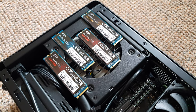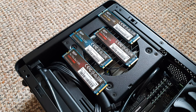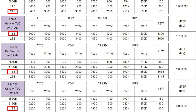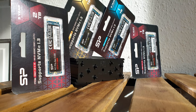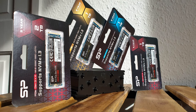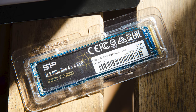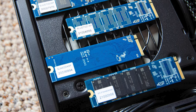From top to bottom we have the only Gen 4 X4 US70, then the UD70 which uses QLC cells, and then the A80 and A60 series. Pricing will be linked in the description below since there are too many models to cover in one go. All the models come shipped in a minimalist yet effective enclosure that lets you see the actual M.2s, with differences in color theme and stickers so you can tell them apart. Opening them up, this is the minimalist transparent plastic clamshell that protects the SSDs. All of them use a blue standard PCB and the chip layout varies between single-sided and double-sided.